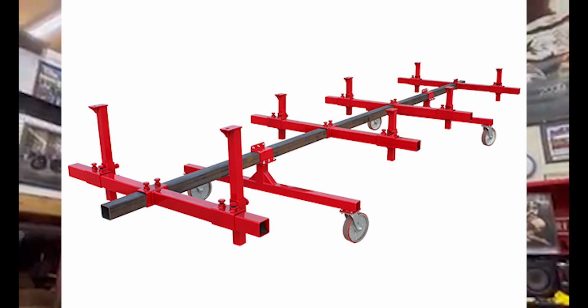Last time I left off was on the frame rail when I found out they were kind of like Swiss cheese. So we ended up ordering two new frame rails, left and right, and an Auto Twirler Pro cart. It's an expense I didn't really want, but in order to replace those rear frame rails, I've got to jig the car so that it will not move.